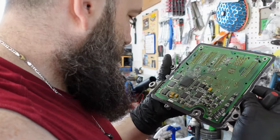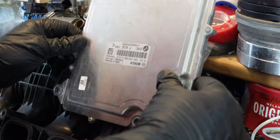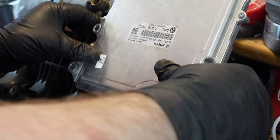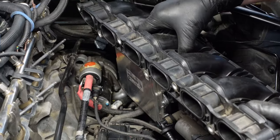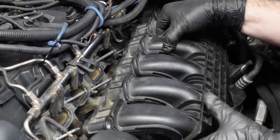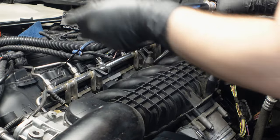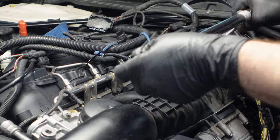There is a bit of a gasket on the intake manifold. Just clean it up when you go to throw the DME back in, and then the intake manifold is ready to go back into the vehicle. Because the O-rings were barely used, we were able to reuse them. They're just soft rubber at the end of the day, so we reused those and, rinse and repeat, threw the intake manifold on, torqued it to spec, charge pipe, made sure everything's tight.